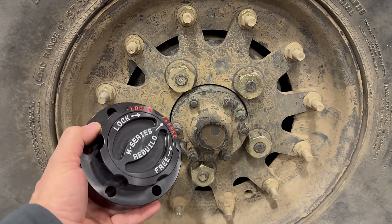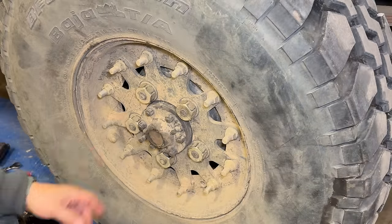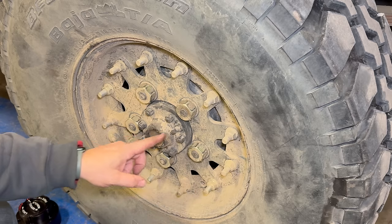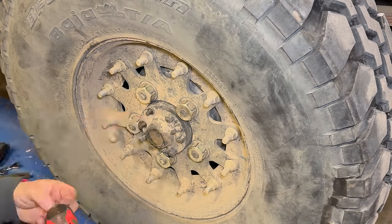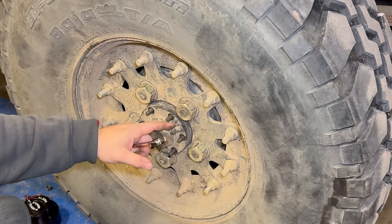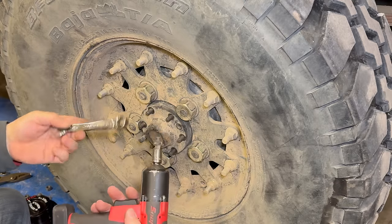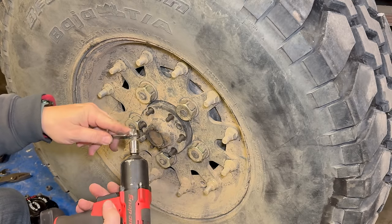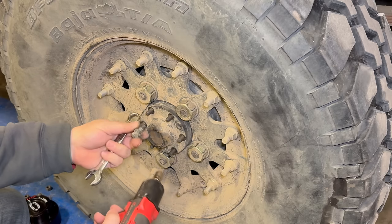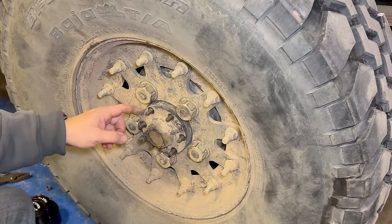I think these are the strongest ones you can get for this truck — there's no way I'm going to be able to break these. Let's get these installed and see how they look. They've made removing the original hub pretty easy — you just undo the nuts that hold it on, then use two bolts to push it off. I'm going to spin these bolts out so I can thread the nut in further, so that when I put the bolt in again it will go in further and push this out and off.